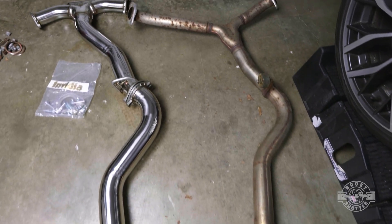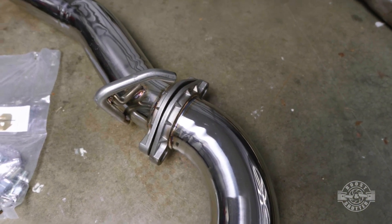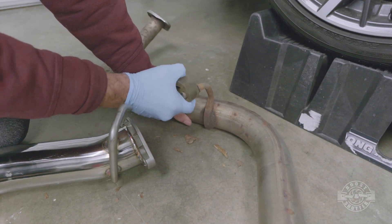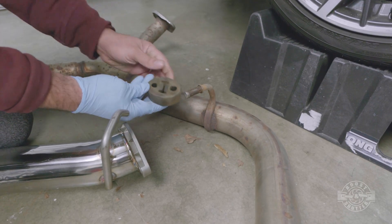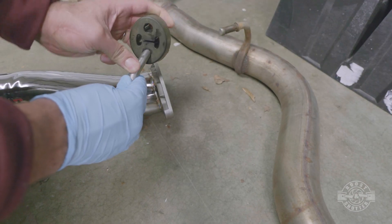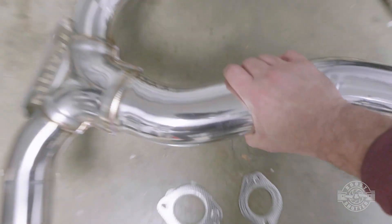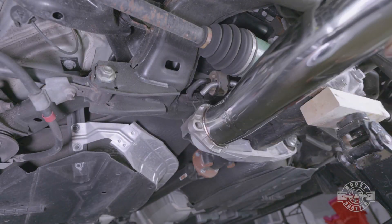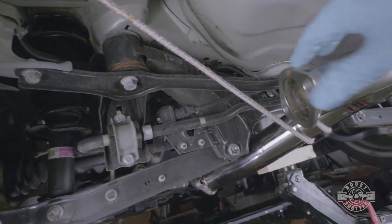Now here's the side-by-side view — make sure to check out my video review for a more in-depth comparison. This right here is the hanger we just removed, and since the hanger stayed on the pipe we're gonna just remove it from the old pipe, give it a good cleaning, and then we're gonna put it on our new exhaust right here. Go ahead and grab the rear portion of your new catback and put it back on the hook. Spraying a little WD-40 on the rubber hanger will make it slide in easily. I use some bungee cord to hold it in place for the next step since I'm doing this alone.